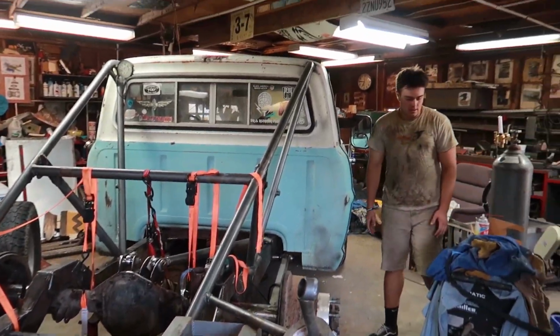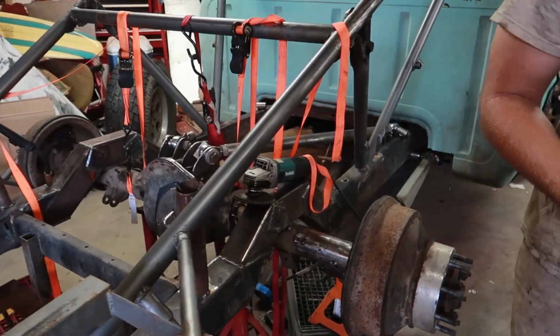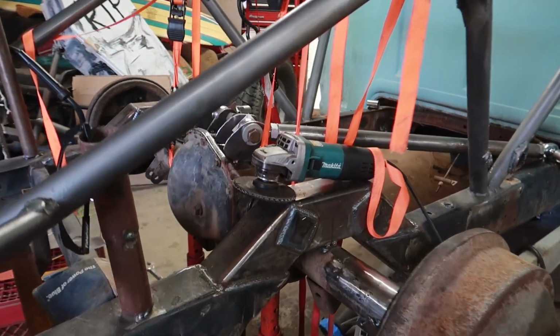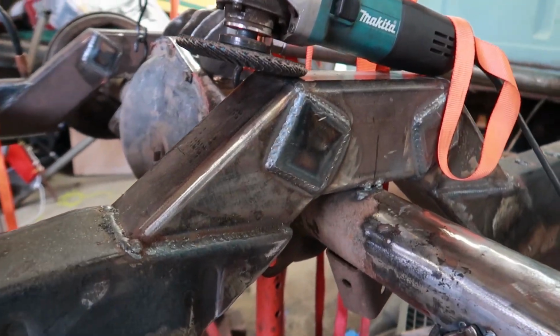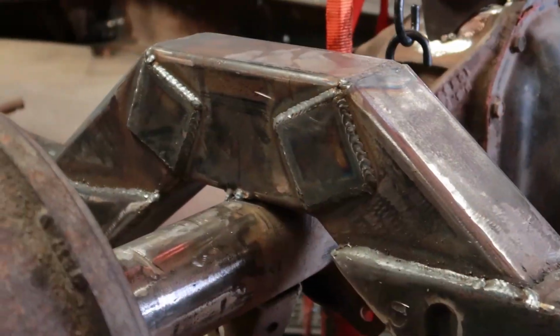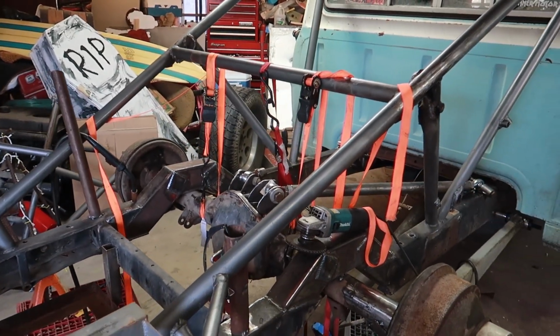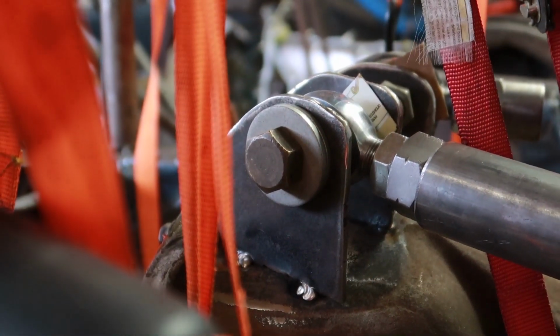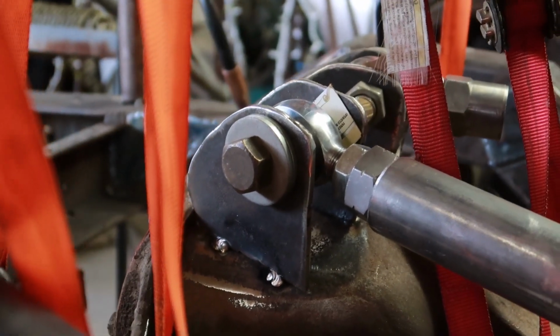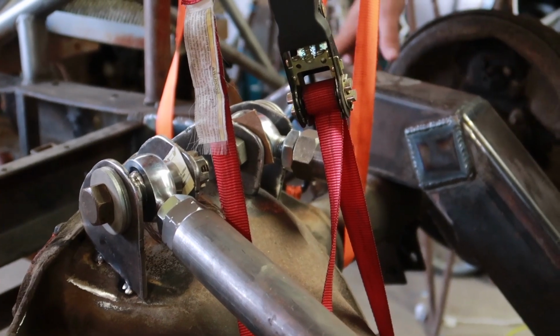So run me through what you've done since then, because it's kind of a lot. The notch has been a pain in the butt because the plasma cutter broke. So I had to cut those to miter them, which is 3x5 square tubing we had laying around in my shop. Then I did some overlay plates for them, welded that in, cut the rest of the frame out, and boxed the back of the frame in, so that's all sealed off. Then I started the link mounts on both of these.